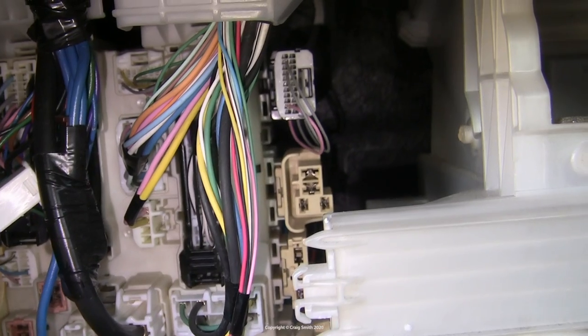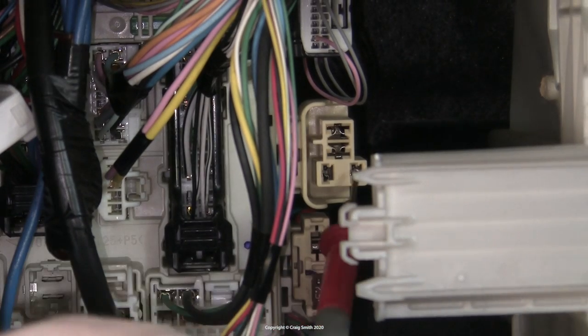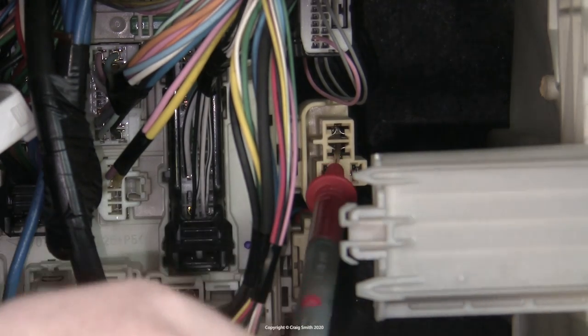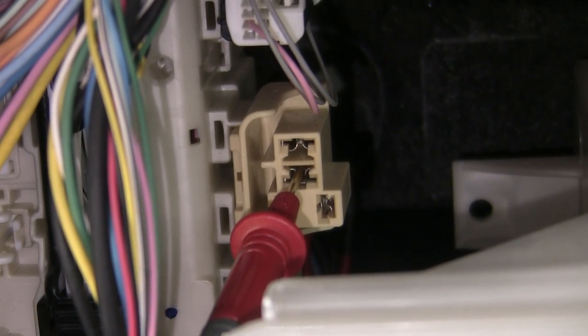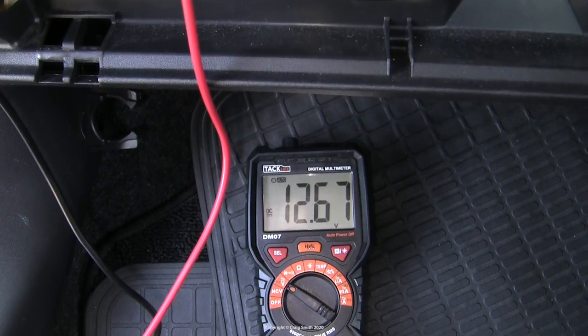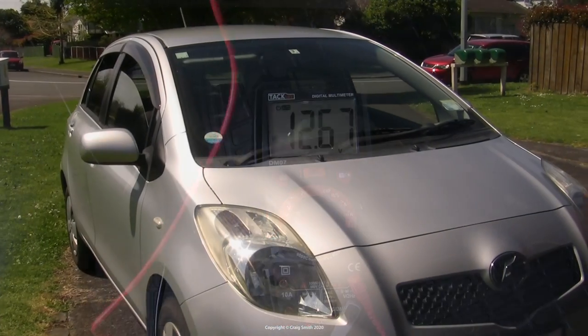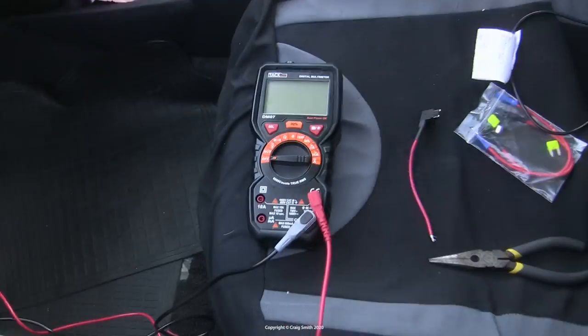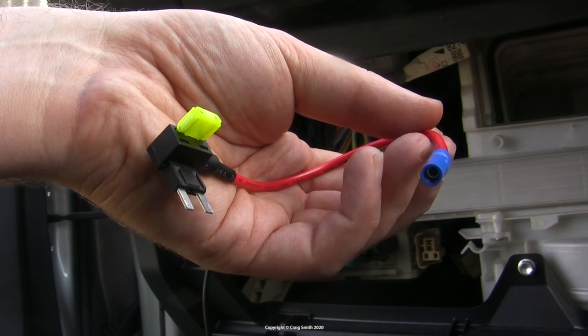I was thinking I might have to wire-tap a cable, but I realized there was an empty socket above the ACC fuse I'd found, with four connections. I'm not sure what it's intended for, but it is wired up and not being used — nothing is plugged into it on this car. I stuck the probe into them and lo and behold, the middle one gave me live voltage. So again, you do need to lock the car up, let it time out, and then come back and check. But I can tell you this little cheat gave me permanent power, so I figured I'd just use that.